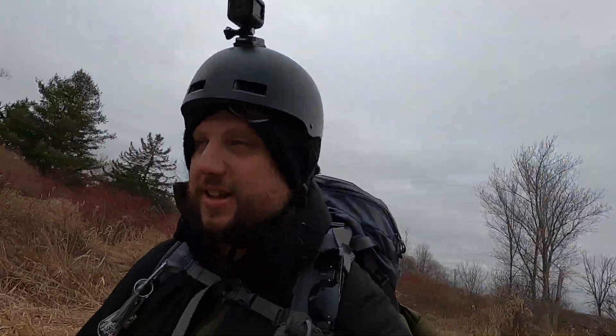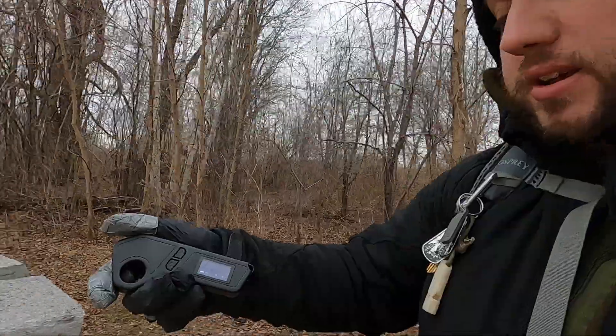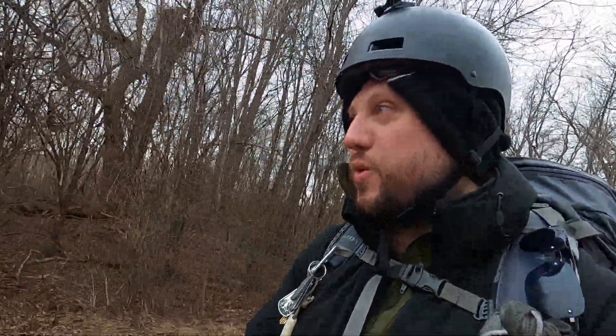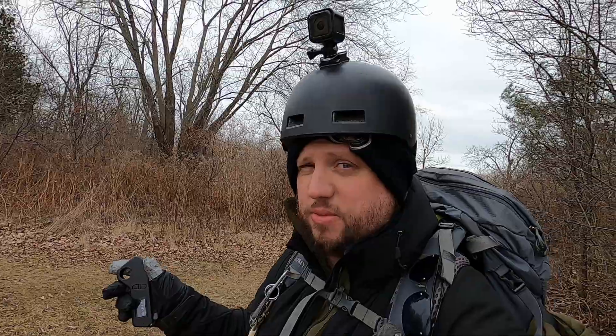As you can see, we're getting quite a lot of voltage sag at this point. We're not even at 8 kilometers yet and the board was already beeping at me. We're on an outright crawl now — flat level ground, maximum throttle, and we're doing 8 kilometers an hour. The voltage sag on this battery is nuts. The battery definitely doesn't have much life left in it, so I'm a little shy of my 10 kilometer turnaround point at only 7.4 something. Let's start limping our way back until the board just outright dies and refuses to move.